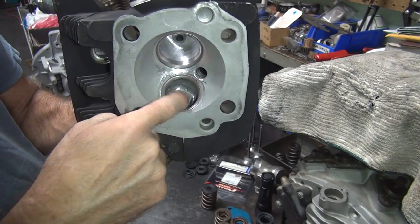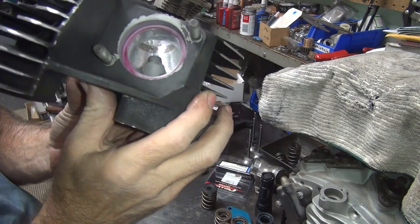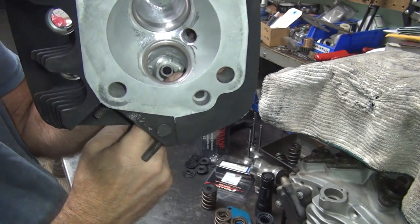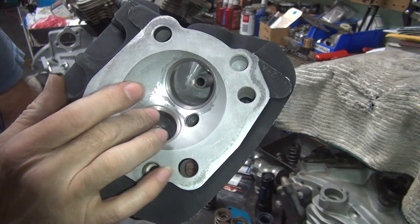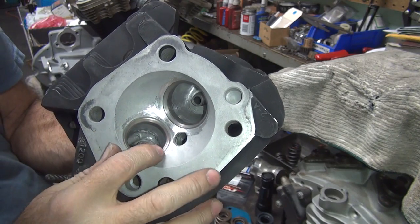The exhaust - we did the same thing. We opened up the seat and then opened up the bowl below it. The actual throat of the port down in there we didn't really do much cutting - we just smoothed it up. It's already big enough. Most of all the cutting is down inside the bowl next to the valve guide. You basically want to get your finger to go up both sides of the guide hole. And then I blend it up here on the top, taking out the edge that was up in there and smoothing it up.